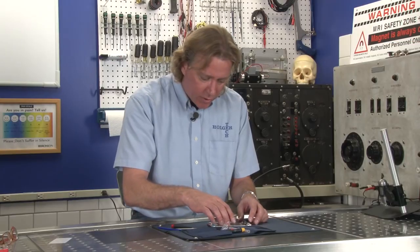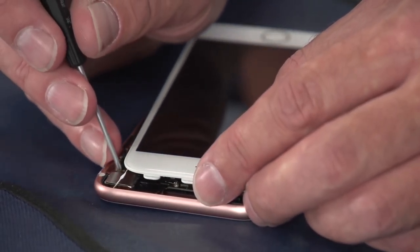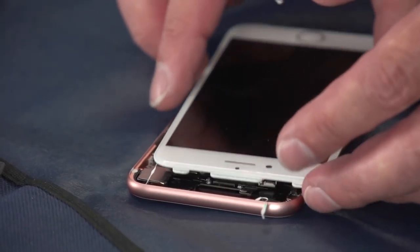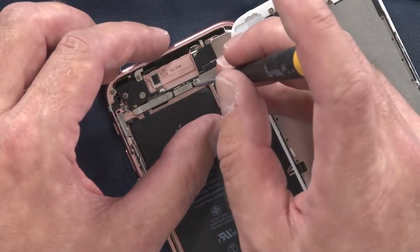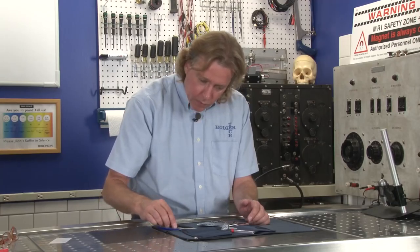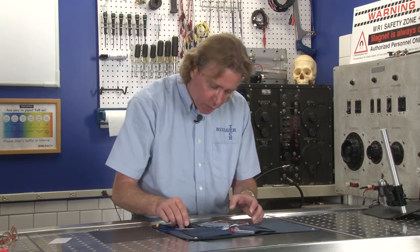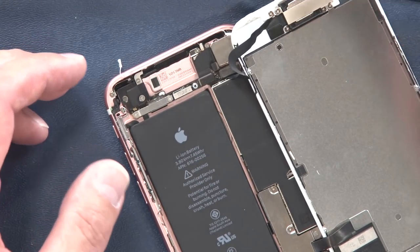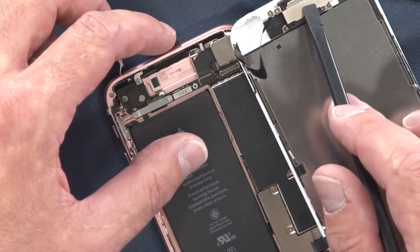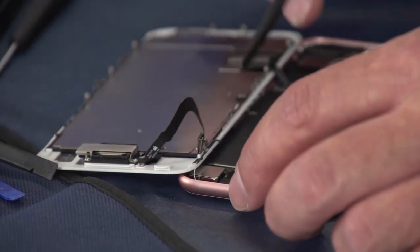Let's proceed and see how much of this we can take apart. I see a small screw along the top — those look like standard double-zero Phillips. We'll remove the two screws that hold that shield in place, keeping all my screws very well organized. With a nylon spudger we'll carefully pull that cable up and out — as I said before, this is the cable assembly that transfers data from the front-facing camera, ear speaker connections, proximity sensor, and ambient light sensor.